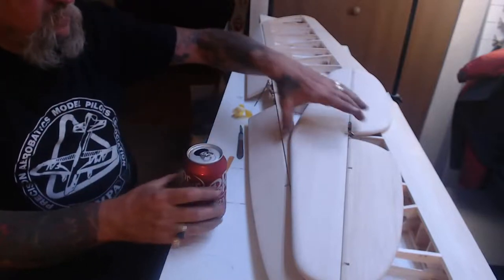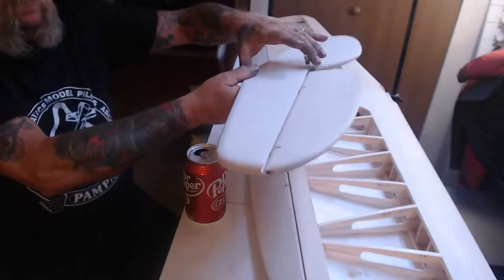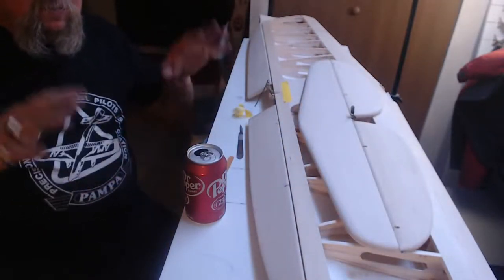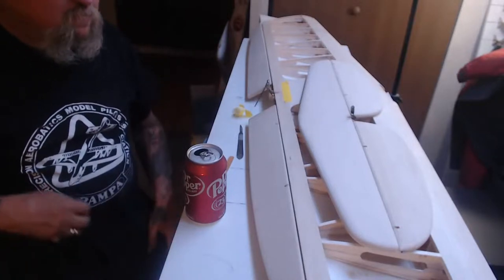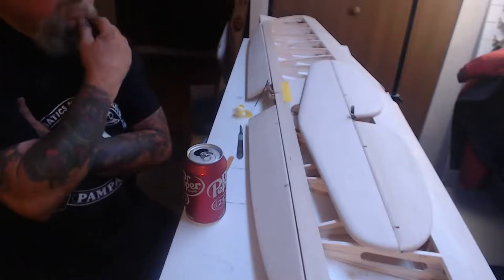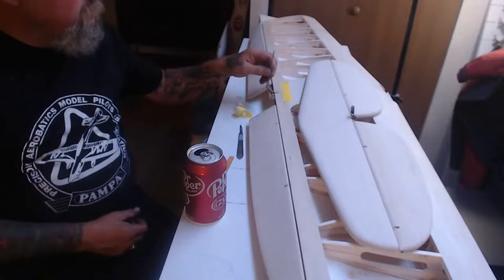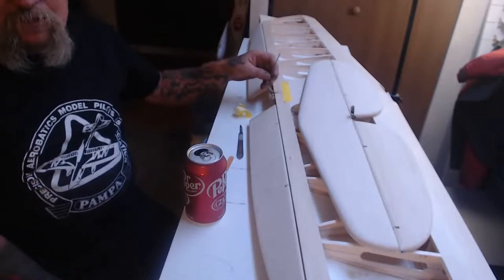Oh yeah, they don't work. You can't get them to work any better than that. Your airplane, when it's sitting on the ground, the flaps should be down under their own weight. Elevators up, flaps down. And that's part of the reason why I'm dumping the ball links. That and they have a tendency to bind up in weather.